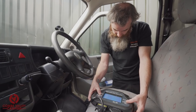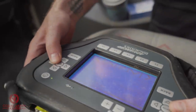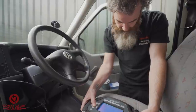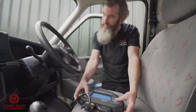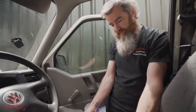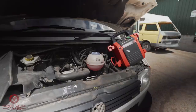Okay, so here we go — we're going to go to Volkswagen. The tester is asking for the chassis number — Transporter. Read pin code — yes. AJT is our code — yes. Switch ignition on. Okay, so we tried to pull the pin code on the first attempt and it came up with an error. So I've put a jump pack on the battery to boost the power and we've tried again — and it's come up with a pin code. I won't tell you what it is, but it has, and we'll be able to program the key now.